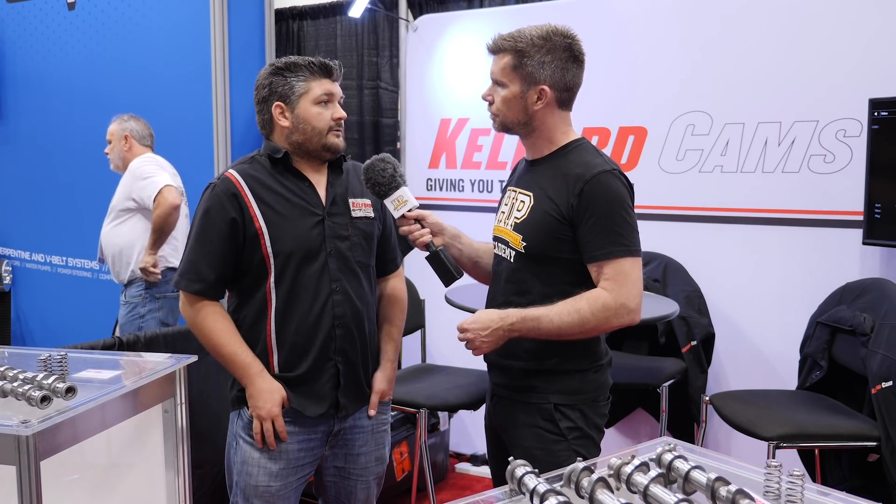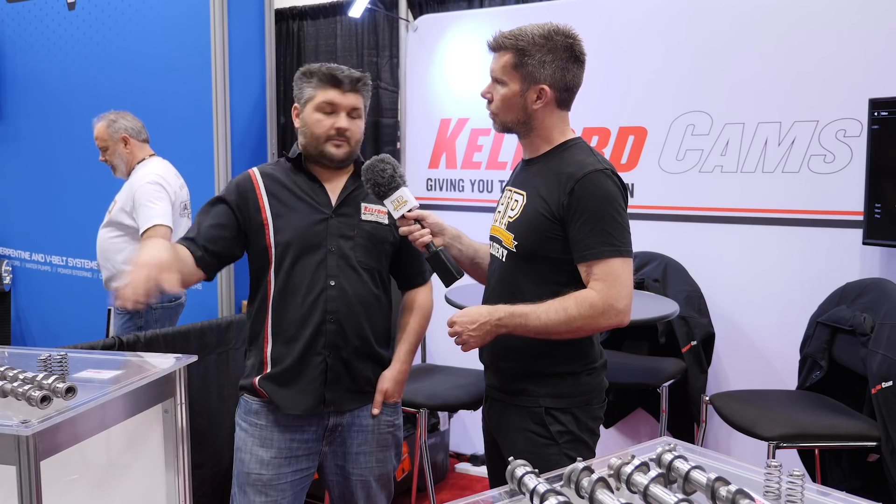With what we've seen in some of the testing — just some really mild cams — we've done a couple of setups and just done exhaust cam swap-outs and nothing else. We've seen 50 horsepower increases just from a cam swap, everything else being equal, for the entire power range. That's pretty significant when you can gain power everywhere. Yeah, they lose nothing and they gain everywhere. And that was a smaller setup than what we've got here, so at some point you're going to start losing a little down low to gain more up top.